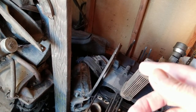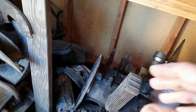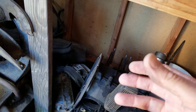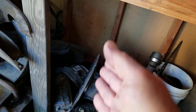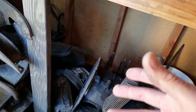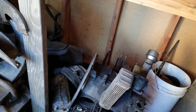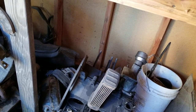that little flywheel with four dowels or even eight dowels in it. And every time you rev the engine, it actually puts more stress on those dowels. So if you put a lightened flywheel on it, it takes some of the stress out of there, so that when it revs up, it's not trying to rev that heavy flywheel. You're better off when you build a performance engine going with a lightened flywheel. That's why people do it.